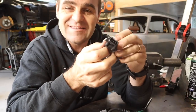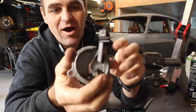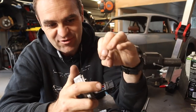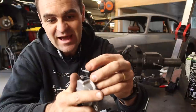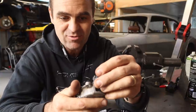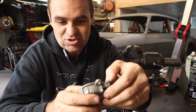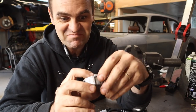It's little things like this that really make these jobs take so much longer than they need to. I went through and de-pinned this plug, extended the wire slightly, soldered it all back together again, reconnected all the pins, and glued the clip back together again. So now I have what should be a working cam angle sensor again. I could probably source another one if I valued my time as money, but this is going to work — it should be fixed. So I can put this back on and get back to where I was an hour ago.